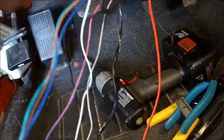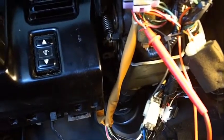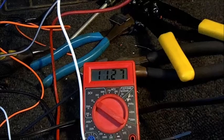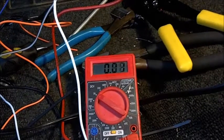For me, it looks like I'm going to have to extend this wire a little bit — solder on a couple extra inches so it's able to route nicely and not look sloppy. The next wire I'm going to be doing is our parking lights. Your parking lights are going to be either positive or negative trigger. On this car they're going to be a positive trigger — your red with a blue stripe, right here at the big harness all the way to the left. The white wire from the alarm will go to it, running it up along with the horn wire since they're right next to each other. I flicked on the parking lights and there you go — 12 volts. Switch off, switch on, switch off. That's your parking lights.